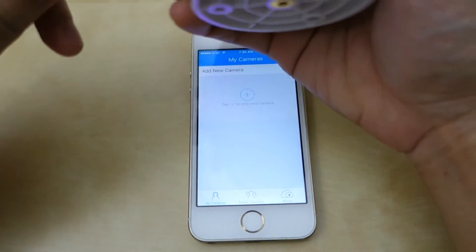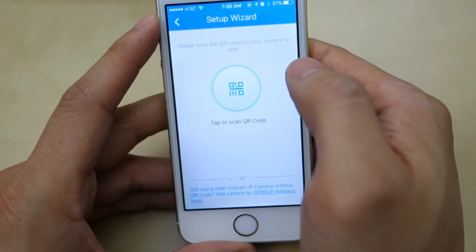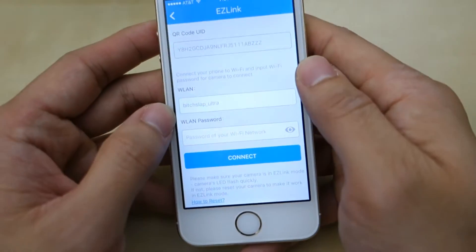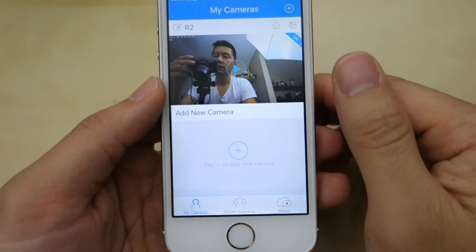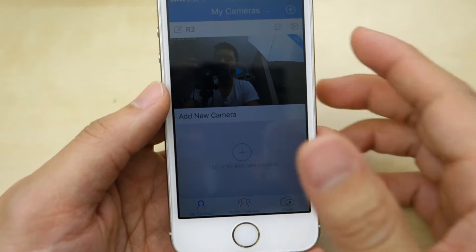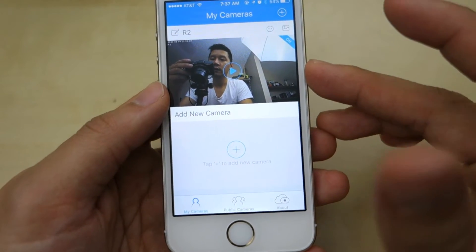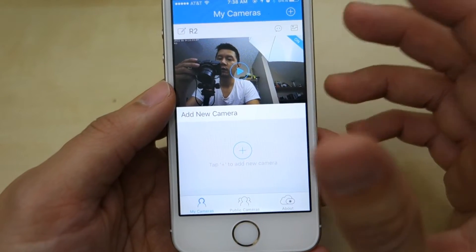I'm going to give the camera power now and it will come on. In the app, all I have to do is tap 'add camera' and it will ask me to scan a QR code located at the bottom of the camera. The camera is currently spinning up using my current Wi-Fi. I tried connecting using the 5 GHz frequency on my wireless router and that doesn't work — the camera only supports 2.4 GHz. Also, when setting up in the app, it will only let you select the last Wi-Fi this phone was connected to, so make sure you're connected to your 2.4 GHz network first.